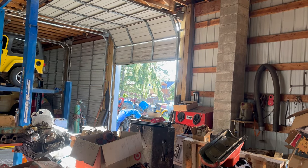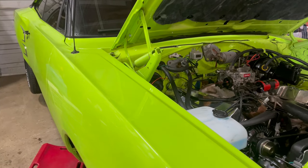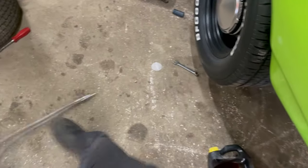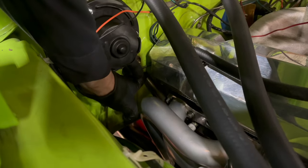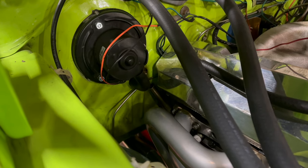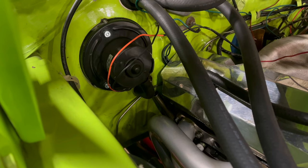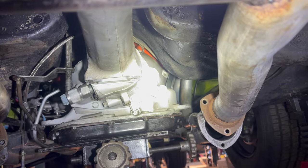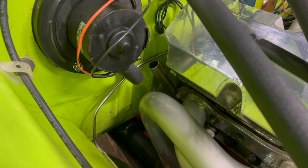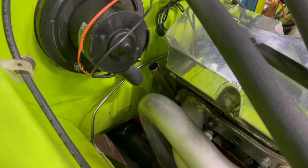It's some hours later and the sun is out — it's actually warm outside. The transmission is loosely attached to the back of the 440 with two bolts, and I'm doing the flexi transmission dipstick tube delete. Unfortunately, the new one hits everything, especially the cylinder head. I'm modifying its hold-down bracket to see if I can get it lined up — this may involve a hammer and a torch. I have like an hour into getting that hole to almost line up. But it's in, and thankfully no one will ever see the horrible butchery involved.